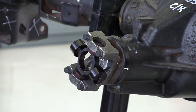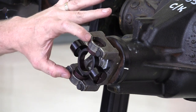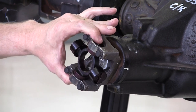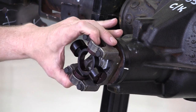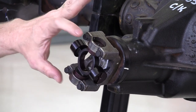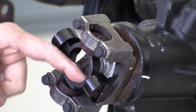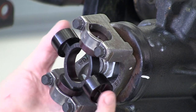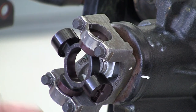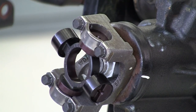I've got the tool bolted down with the U-joint straps. As I was reading in the service information, these straps are not reusable, neither are the bolts — it's been that way for many years. Of course everybody reuses them, but just be aware it does say in service information that the straps and bolts are not reusable. There's an inside surface right here that's machined on a kind of an arc — it's like a bowl on the inside. So it doesn't really matter if this little U-joint adapter tool is tilted slightly; we want it lined up as flat with the surface of the flange as possible, but it does not have to be perfect because of that machined surface area.